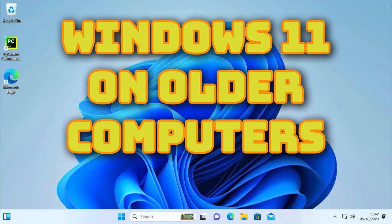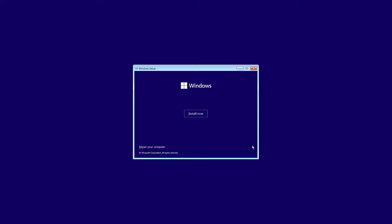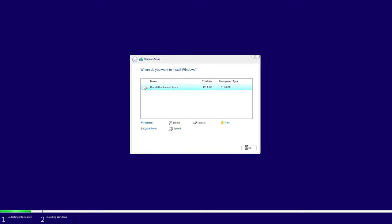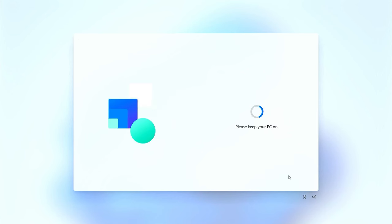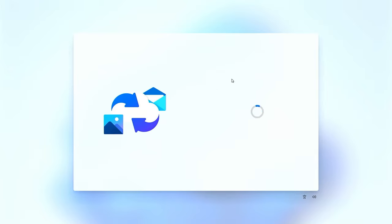To install Windows 11 you'll need to use a workaround as these machines don't usually meet the minimum requirements. Please do check out my video covering installing Windows 11 on unsupported hardware — I'll put a link to that in the description below. First off you'll need to get into your BIOS settings to allow booting from USB. These devices are usually protected by a BIOS password, but it should be set to the default for your device or the seller should tell you what it is. Either use that or do a web search for the default, and from then on it should be a fairly straightforward installation of Windows.